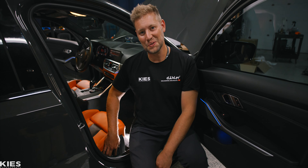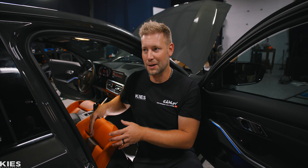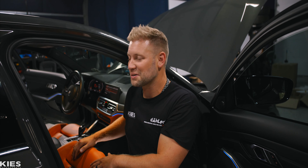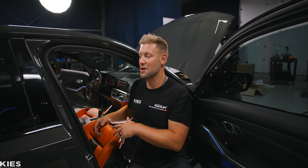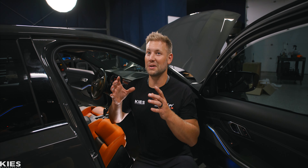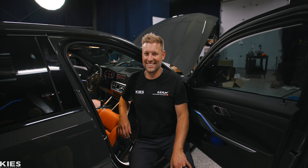We got power — it was a joint effort with a lot of trial and error. We had the factory box and it didn't work, then the secondary box from the M340i, that didn't work either. We took the driver module from the factory M340i and hooked that up — it worked for half a second and then failed. So then we plugged part of the electronic system into the M340i box and the rest into the factory box — that didn't work. We used Pro Tool to code the car to have M Sport seats — still didn't work. Finally, Zach plugged the box from the M340i driver seat into the passenger seat fully, and it works.